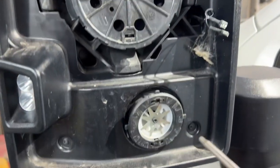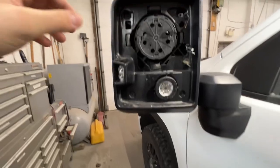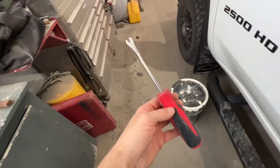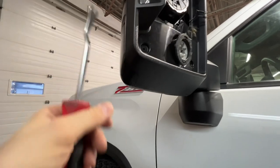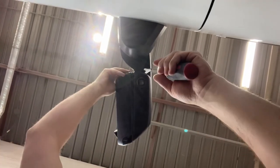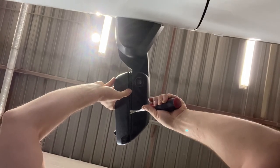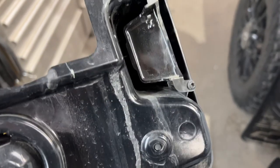That was easier than the top glass, that's for sure. Grab your screwdriver — there are going to be four T10 Torx screws; take those out. With the screws out, the whole top is loose and the only thing holding it on is the bottom. Grab your fork or prying tool, put a little pressure pulling it back, and just start unclipping. It might sound like it's going to break but none of them are going to break. Once that's done, don't forget to unplug your light — just the one connector.